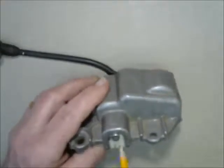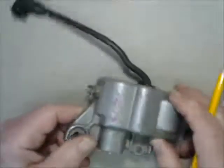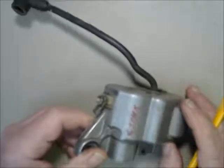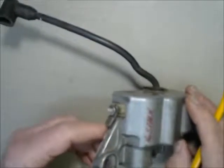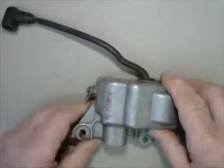The 906 looks like this. This is the trigger assembly here. There's a trigger coil in here and a magnet. This is the pull piece that interfaces with the trigger pin on the flywheel to generate the trigger pulse. Over here we have an AC input that comes off of the stator. On the stator there are two white windings, and those two windings output the AC voltage which provides the electrical power for the ignition.